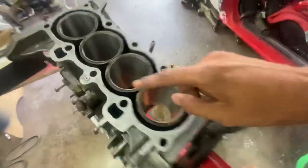If you look at this block, we got a JDM D15B with an oil dipstick in the middle just like an EF engine. D15B is basically an umbrella term — it means four or five different engines. There is literally a D-stroked D17 only compatible with 2001 to 2005 Civics that is also called a D15B, even though it's an entirely different block.